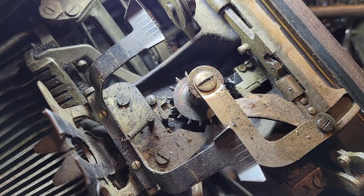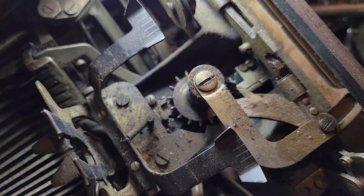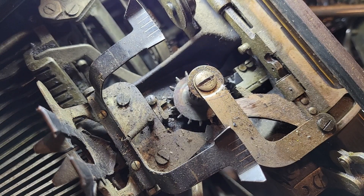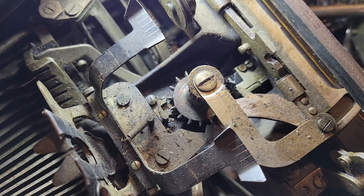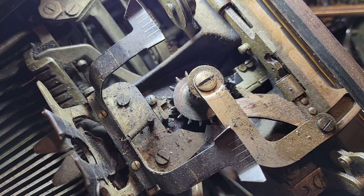I'm about to conduct something monumental for me. This is a Harris Visible, which was packed decently, except that the seller unfortunately was not able to find the carriage release, meaning that the spacebar was depressed during shipping, and the carriage received a large jolt that snapped this tooth off. That means that when you press a key, it basically acts the same as a carriage release, which you don't want. This is absolutely essential for the proper operation of the horizontal spacing on your typewriter.